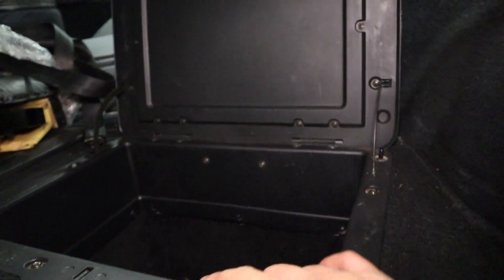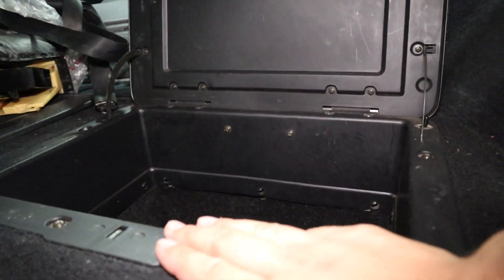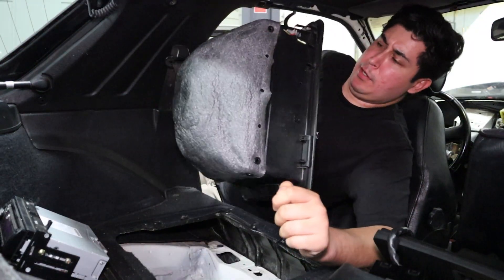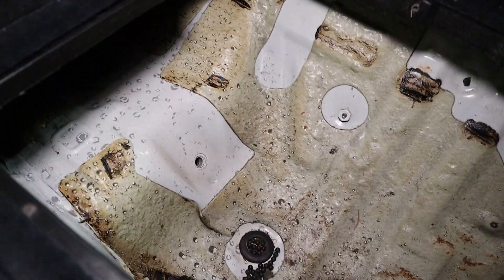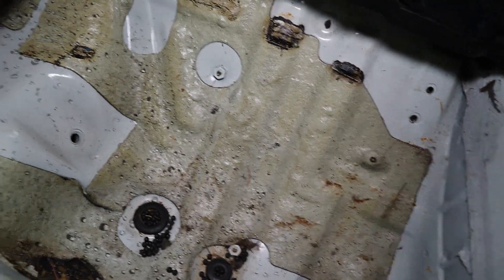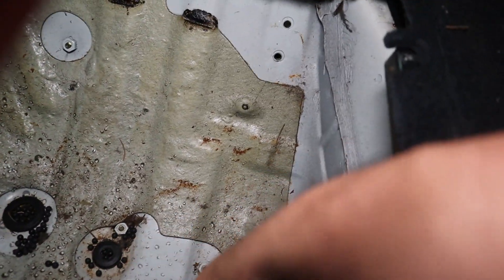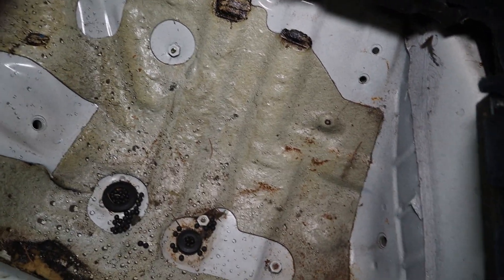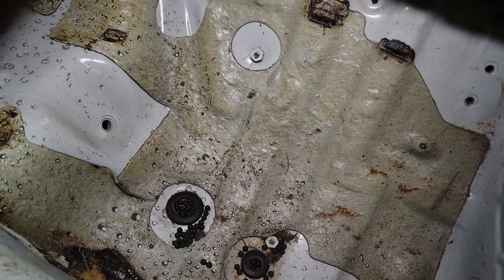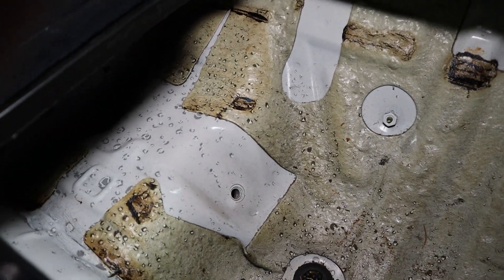Now that we've figured out what we're going to be using to power this car, we need to figure out how we're going to mount it. I'm going to pull this bin — it looks like just a bunch of Phillips head screws. In its place we have pretty much where a back seat would go in the 2+2 version, but we don't have that. The nice thing is we do have a few bolt holes in here that we can use as mounts for a little battery tray.